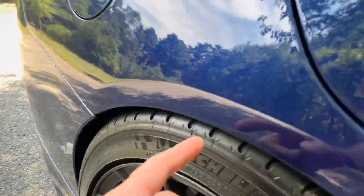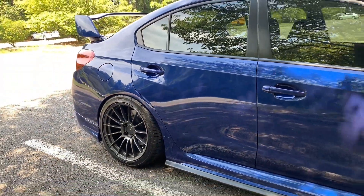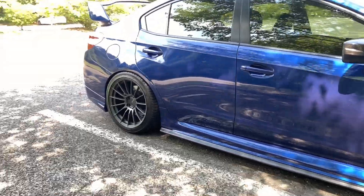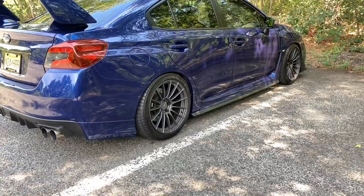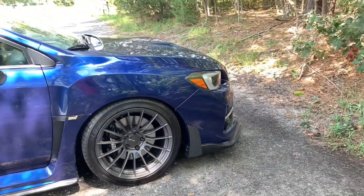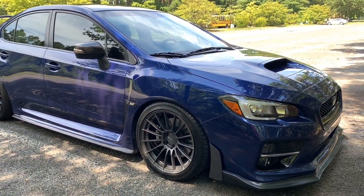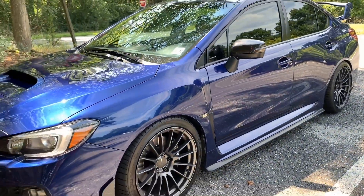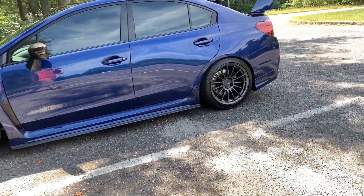The rears are a little more tight — you can hardly get a finger in there. I am running around negative three camber all around. I do have my rear fenders rolled as well, which is also a question I always get. I had some pretty serious rubbing before I got the fenders rolled. So if you are planning to go as low as me — which is about a one-finger gap — you're definitely going to have to get your fenders rolled.